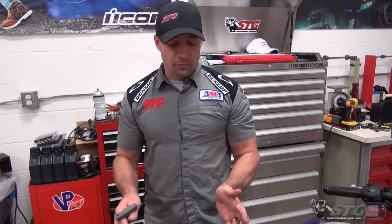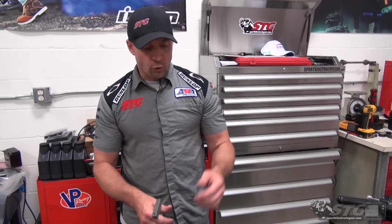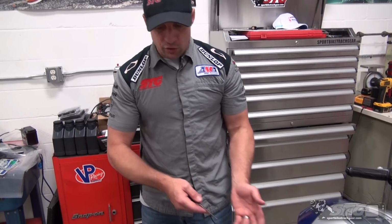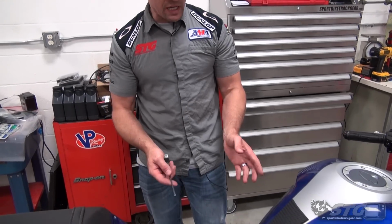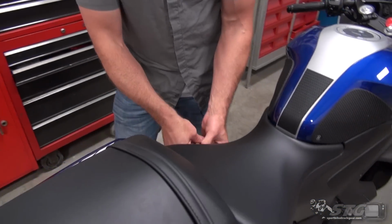This is a pretty involved project, okay? This should give you an idea how to do it yourself if you've never done this before. If you're not comfortable after you watch this, take the bike to a licensed mechanic, have them do it for you. We need to pull the gas tank off the motorcycle. Before we can do that, we have to get some trim panels off. That'll allow us to get to our seat and pop the seat off. So I'm going to begin with our two side trim panels,